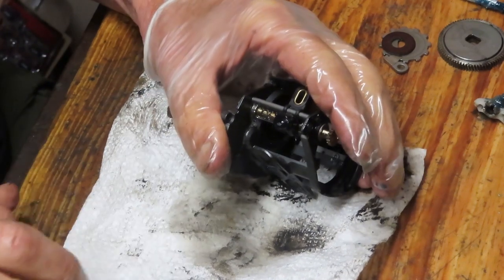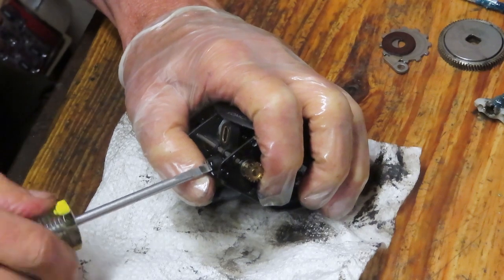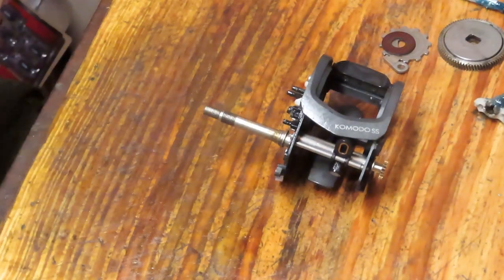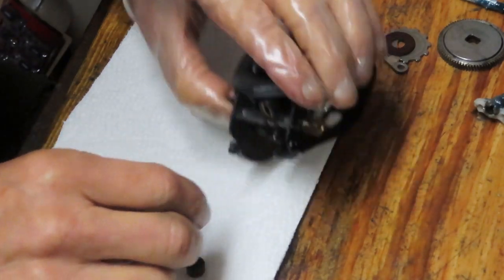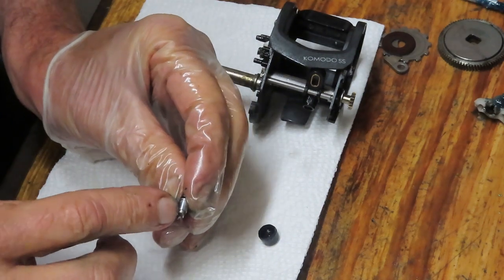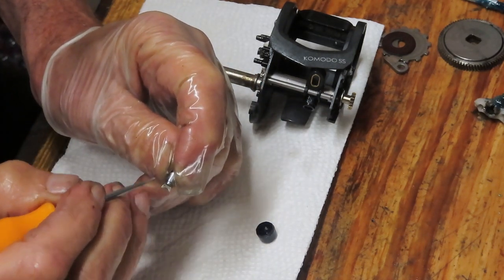I find penetrating oil is good for flushing — it's a degreaser and it helps to just flush it. You can push the pole in and out and there's the dirt we've seen in there — it generally pulls it away. Clean off the dirt on the cylinder, and there's usually a little bit of dirt on the shoulders too, so just run a pick across there and knock that off. If you don't, that's going to clog, and eventually the track that it rides in on the worm gear is going to get clogged with dirt and it's just not going to work properly.